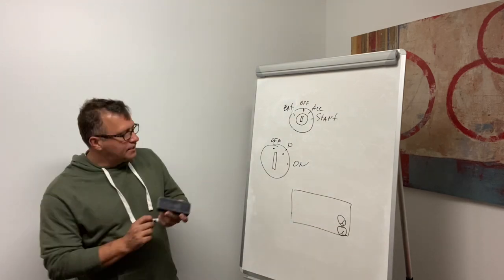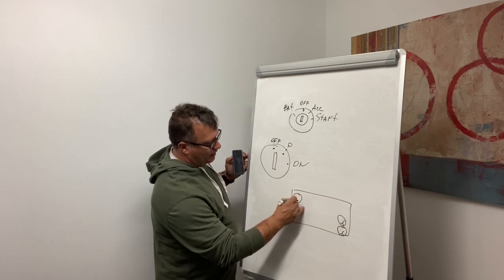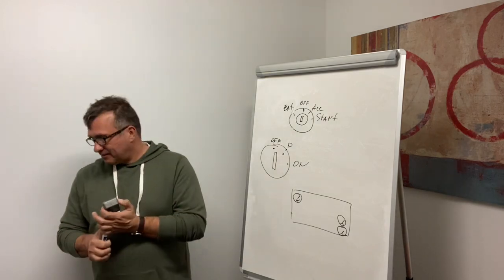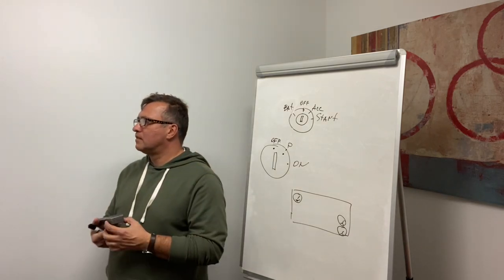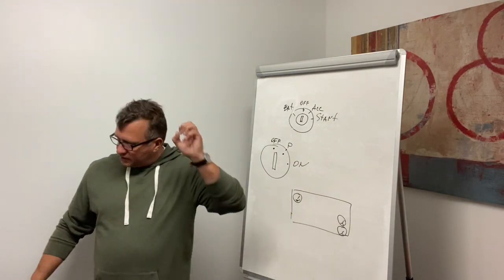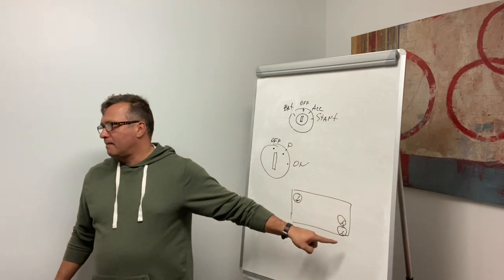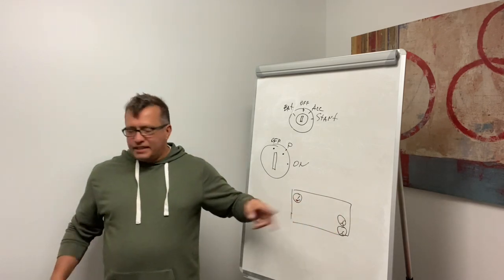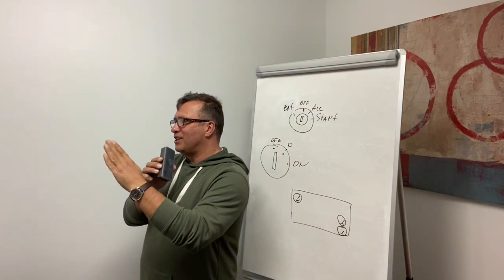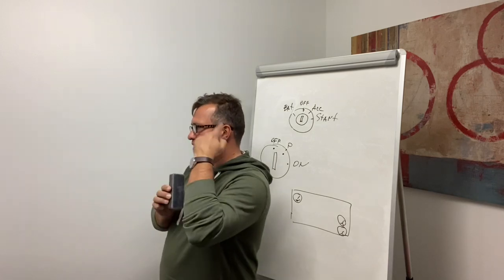Next gauge will be like this. Oil. So once the air goes up to between 120 and 140, it will sneeze, it will cut off. There are two of them, primary and secondary. They work together, and secondary supplies primary. Primary loses air first, but secondary supplies it. I will tell you why it's important to understand.